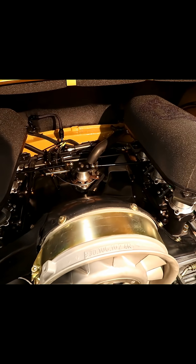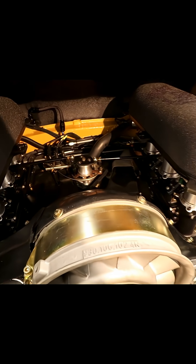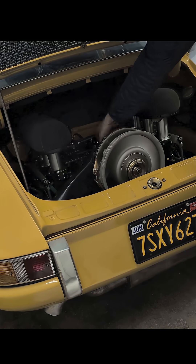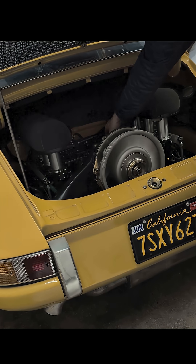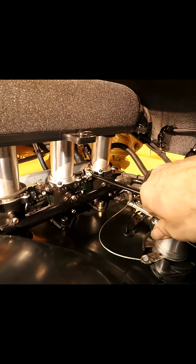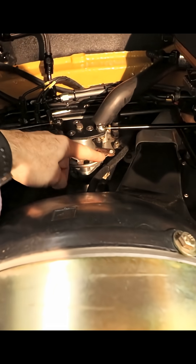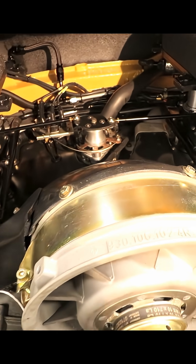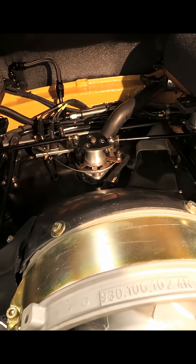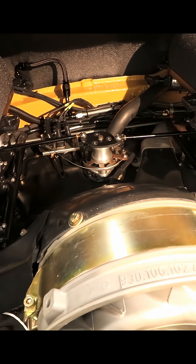I do have a mechanical linkage that ties the left and right throttle bodies together, and I like to be able to come back here and just grab this thing and rev it up. Mine's a cable drive, which gives similar adjustability as drive-by-wire. I can change the shape of this curve right here to adjust when the power comes in — do you want it to come in immediately when you hit the pedal, or more in the half-mid-range part of the pedal travel?